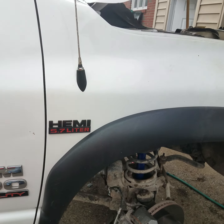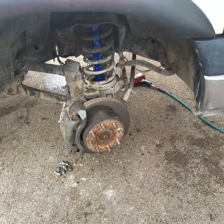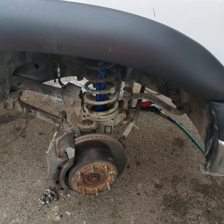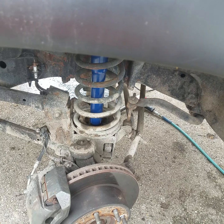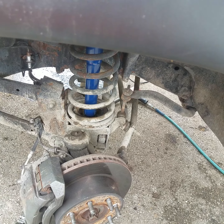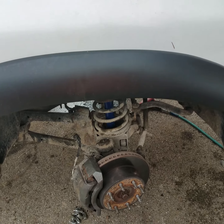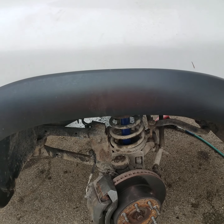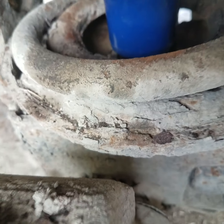On a Dodge pickup truck, whether it's a 2500 or 1500 with a Hemi or a Cummins diesel, the front shocks — where they put them on at the factory — they put a retaining clip on the frame support. The shock mounts with a slug, almost like what an oxygen sensor is held in with. That slug is held by a retaining clip that locks onto the frame and is tack welded in place. Well, they break, and there's no way to take it out. So a common problem is when you go to undo the bolt on the shock, it just spins on the back side and you can't get it out — you can't replace the shock.